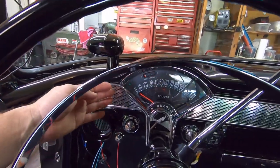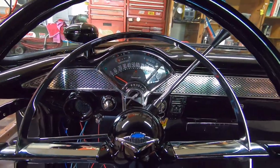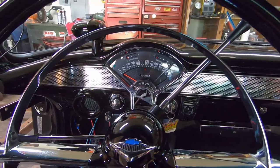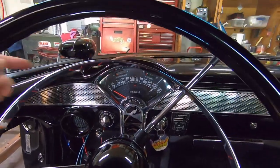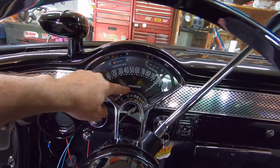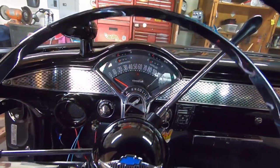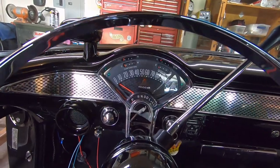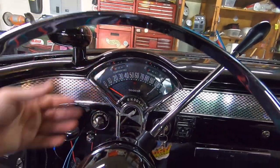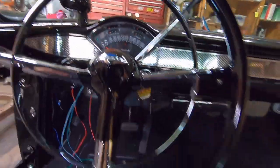I changed it to LED because I am the world's worst, especially in one of these cars, at forgetting to turn the turn signal off if it doesn't cancel — I'll drive for miles with the turn signal on. These LEDs are bright, so I'm glad of that. I used to be a jeweler, so I used my jeweler's saw to cut out the opening for the odometer, and I put a red LED right there for the bright light indicator. Originally these cars had a bow tie that would light up red for your bright light indicator, so I kept it red.